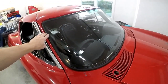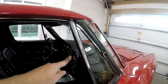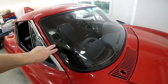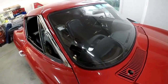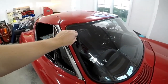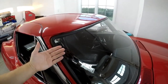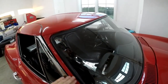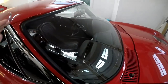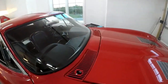First I've got to yank everything out of the inside — just the two visors, the rear view mirror and support, and the four pieces of windshield trim that go around here. I'm going to try to save this gasket, but if I can't, then I can't. Since it's only me working on it, I'm going to put some duct tape from this side of the windshield to the other side, but with some painter's tape backwards or rags so nothing actually sticks to the paint. That way it doesn't flop out, and I'll put some fender covers around for extra protection.